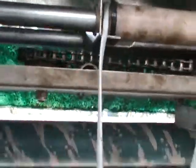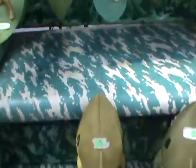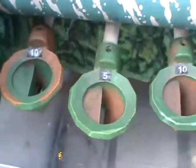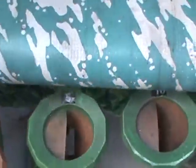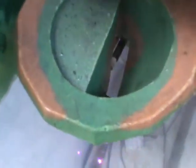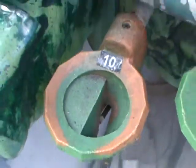So we'll go around to the front now, take a look inside. So there's the display. There's the teeth. And here's the cups. So once again, common problem with these, the connectors come loose and fail, and that usually gives us some grief there. Or sometimes even those little sensors, you could see one of them there, they come out of alignment and we can put that in place. So the teeth are flashing as they should be.